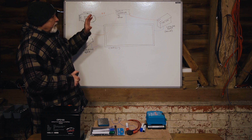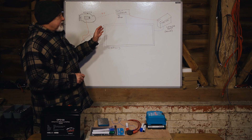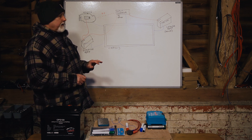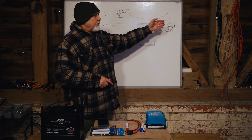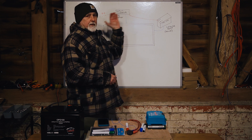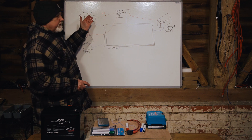On some occasions you might get away with it nine times out of ten — everything's okay just using a split charge with a lithium battery. But it's that one out of ten where things go wrong. If you're lucky, it just messes the battery up. We've known of batteries where the cell swelled up and the battery was made inoperable because of the unfiltered weird stuff coming from the system. If you're unlucky, the battery overheats and you burn your vehicle down.